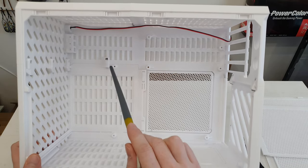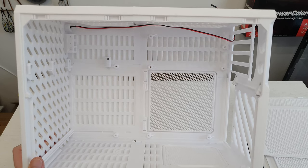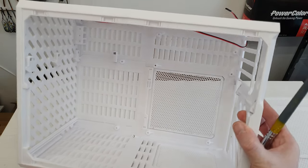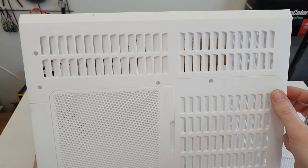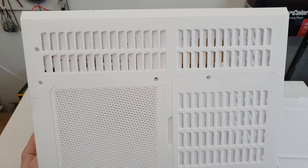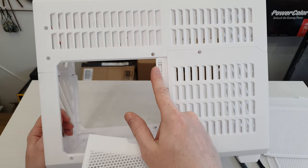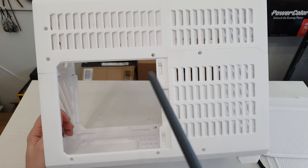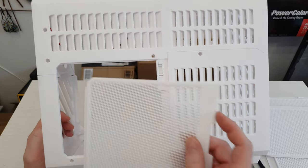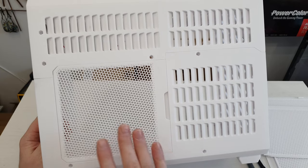In this chassis you install your motherboard on plastic standoffs, and it is possible to screw straight into the plastic to secure your motherboard. But if you have a very heavy CPU cooler, or for some reason you want a better option — for example if you will be shipping the chassis — it is possible to use M3 screws with nuts, and on the back side you can add nuts to secure your motherboard very tight and firmly. Additionally, for easier CPU cooler installation it is possible to open this back door, which uses the same click-in clip mechanism, and you gain access to the back side of the motherboard where the CPU cooler is installed. I really like this option.